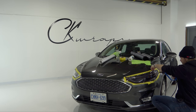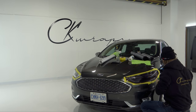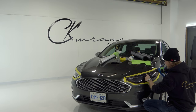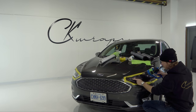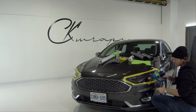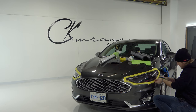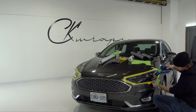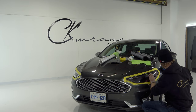It's pretty much that easy to tint your lights on a lot of cars. Let's heat up all the edges — that vinyl is now shrinking down around the top edge, perfect. Let's get it all tucked in under here, all the way down to the edge. Make sure edges are smooth before we cut — just a little bit of wrinkles there. Let's do the bottom, get it all in. I cut it a little bit short but I've got coverage. Let's cut this guy out.